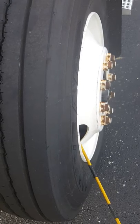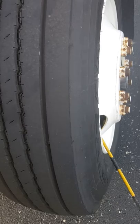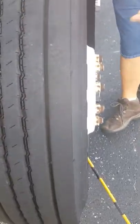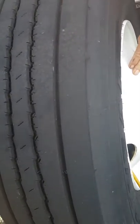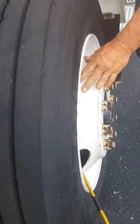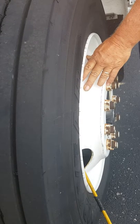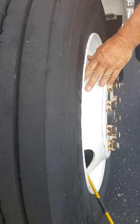The tire pressure was checked with an air gauge this morning and it is at the manufacturer's recommended specifications of 105 pounds. Moving down to my rim, I'm looking at the inside and outside of my rim — it is not cracked or welded, there are no rust trails that would indicate any looseness, no signs of bends, no damage, no repair, no illegal welds. My rim appears to be in good working order.